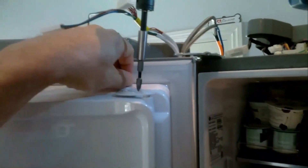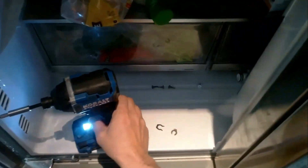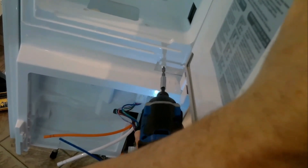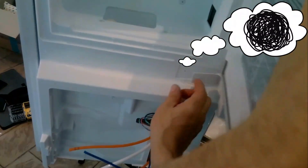So now we're going to remove the door. Just open the door a little bit. Remove the Phillips screw on the far right, and then you'll have two at the top. Once you get the two at the top down, hold the door because it will fall forward. Or you can leave one on the top and then do the bottom — probably smarter to do it that way. So just do one at the top, one at the bottom, one at the top — then open the door and hold it. Then you'll remove the Phillips screw on the left. You have two at the bottom, two at the top. Sorry for the confusion.